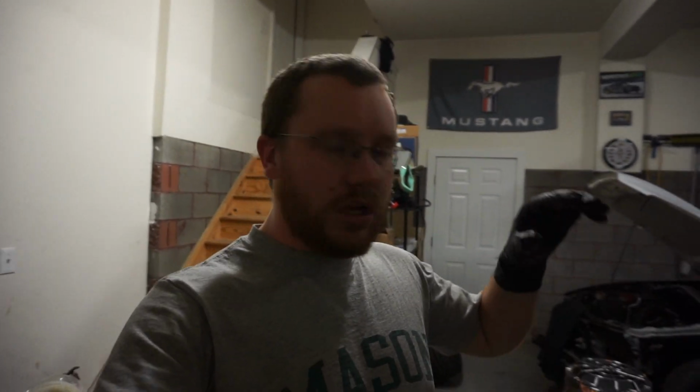what I was doing with the fuel system, drop the tank a little bit more, and actually get access to what I need, because the evap line runs alongside the tank, really tucked up in there, so I have to drop the tank to get access to that. So a lot of under the car stuff right now. I'm probably not going to show a lot of that, but we'll pick back up once we're on the top side of everything.